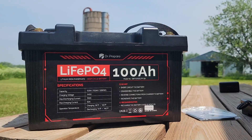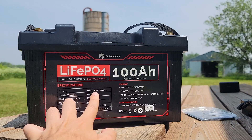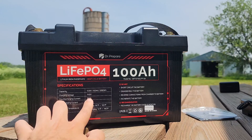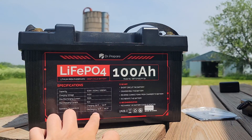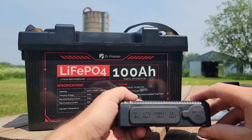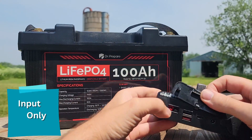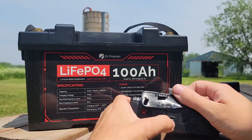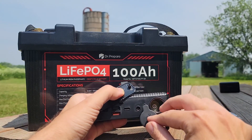This is a 100 amp hour lithium iron phosphate battery. These go for about $400 on Amazon — there will be a link in the description. It is a 12.8 volt 100 amp hour battery, so volts times amps equals watt hours: 12.8 times 100 is 1280. You charge it with 14.6 volts, which is pretty standard for lithium iron phosphate. Max discharge current is 100 amps, max charging current is 50 amps. Operation temperature is 32 to 122°F and discharging is between 14 and 140°F. There is a high and low temperature cutoff on the BMS. One of the things I like is it comes with this little extra hub — big reason I bought this one. I use Anderson power poles a lot, so this has an Anderson power pole port directly on top, plus Anderson power pole port on the side, two USB-A ports, a USB-C port, DC power, and a typical automotive cigarette socket.